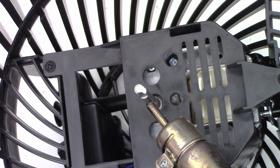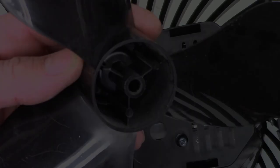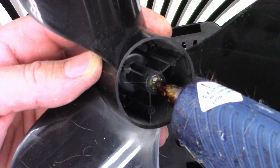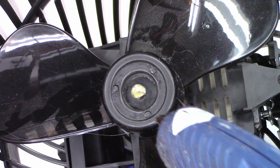I'm going to go ahead and preheat the motor shaft a little bit to help the hot glue melt and take form. I'm heating it with 600-degree air right now. That should be pretty good. Next, I'll just go ahead and inject some hot glue into this in the center. There we go. And I'll put a nice blob of hot glue down in here to secure the threads. And except for the oscillation feature, we'll call that fixed. Okay, hot glue is cool — let's fire this thing up and see what happens.